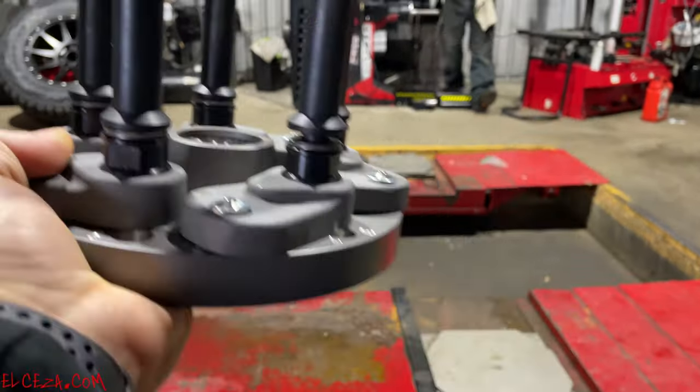Especially now that I've got cameras in there, it will see that weight go by and go, what? And it'll give you some type of error, or it'll ask you to put some weight directly across from it. Okay? Strip the weights off before you start. Guys, it is not worth your time to try to hit that 1 in 1,000 tire that balances out.